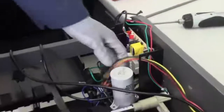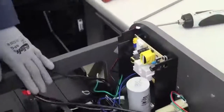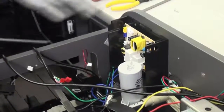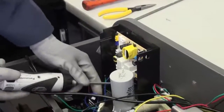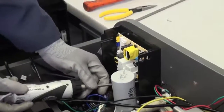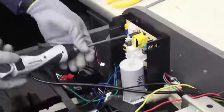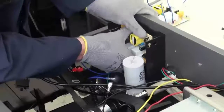Now that we have successfully removed our wires from the PC board, let's go ahead and pull through on the slot over here. The next step is removing the four supporting screws on the PC board located on each corner of the PC board, as well as underneath by the fuse on the bottom right hand corner. You will now be able to remove your PC board and install your new one the same way.